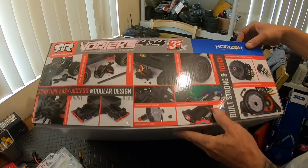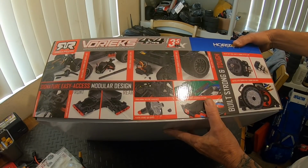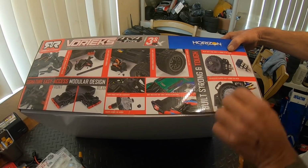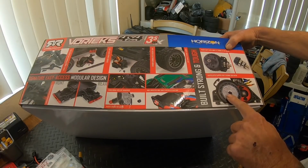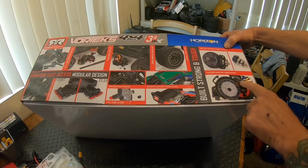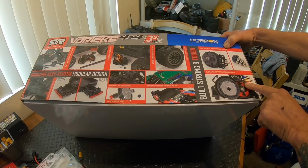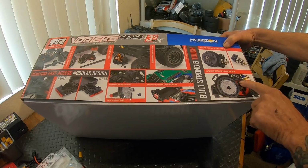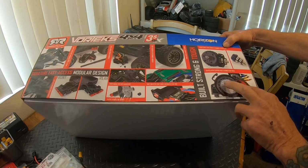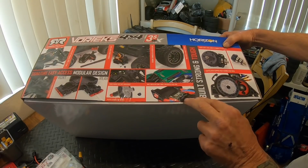some of the stuff. So heavy duty steel input, 1.35 mod, 37/13 tooth gear, slipper pad and sliding gear mesh. So it looks like the V2 Big Rock setup, or no, V3 Big Rock setup, because it's adjustable. So this whole system looks like the V3 style. Does have roof sliders, which is pretty cool. The Big Rock does not have that.